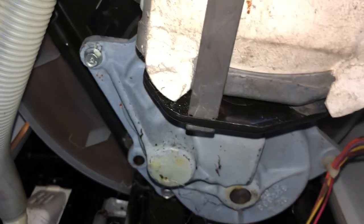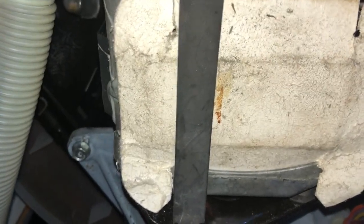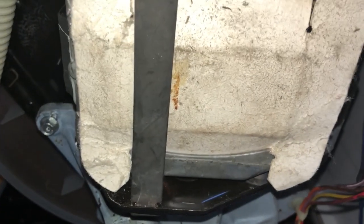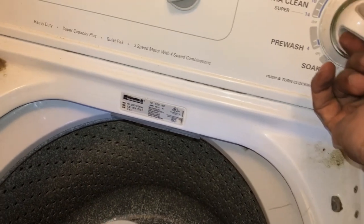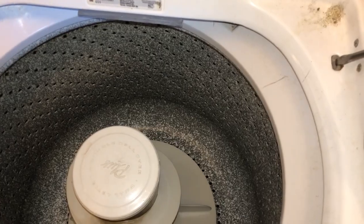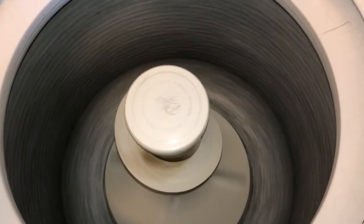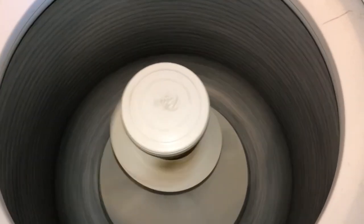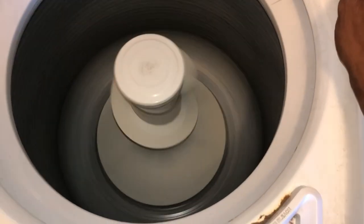Let me get it all back up. The most difficult part was that the new coupling was just slightly thicker than the old one, so I did have to wrestle with it just a little bit, but I got it back up there and I'm going to give it a test run. We already got it on the spin cycle. And there she goes. I would say the job is fixed. TR Rehab.